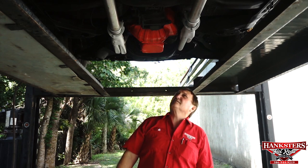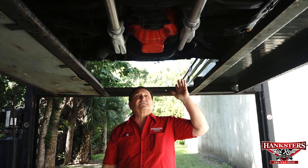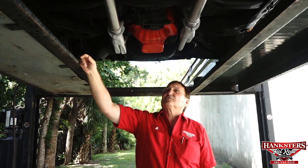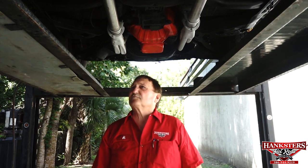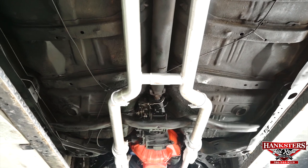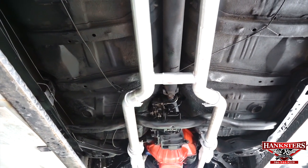There's a cast-iron four-speed in this — appears to be an early Borg-Warner transmission. It does shift well with no leaks. It's a really solid driveline. The structural crossmember that holds the rear of the transmission is in great shape — not deteriorated, rusted, or corroded. The original brake lines run from front to back looking totally undisturbed from 1968 yet. The fuel line is the same way — curved around the frame sections just as it was, three-eighths inch, designated for a big block. The parking brake assembly still appears to be functional and original.